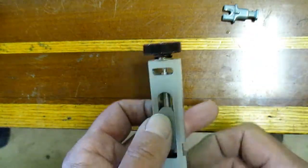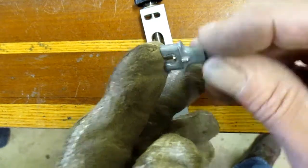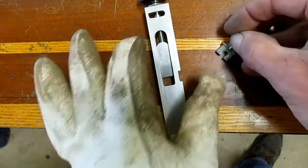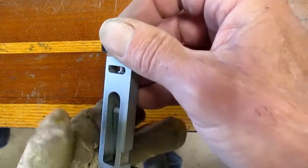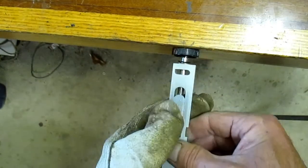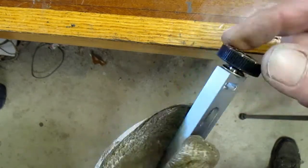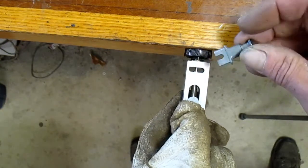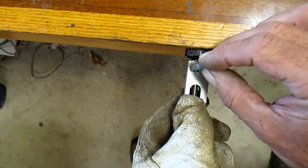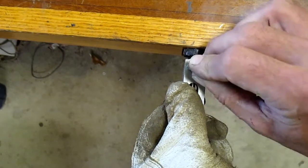The next thing we're going to do is get ready to reassemble. On this piece, there's a little tang right here — that tang has got to face towards the middle, away from the dial. The other side is smooth because there's a little notch in there where it catches that lip. You've got to square this thing up good and don't let it twist around. It's plastic, so it can be a little delicate. Make sure the washer's past there, hold it square with that little tab facing inwards, press in, wiggle it to get it started, and it'll go right in.